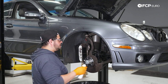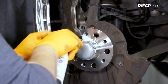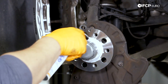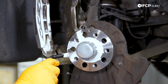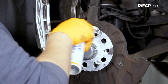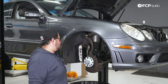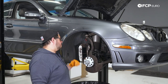We're going to go ahead and apply some Liqui-Moly ceramic paste where the rotor sits on our hub, so that next time someone does brakes they don't have to go as hard with the hammer as we did today. Any excess after we put the rotor on we can wipe off. Now, before we put our rotor back on, we're going to compress the pistons in for the new brake pads, and then we'll slap the rotor on.